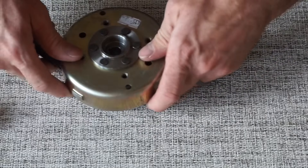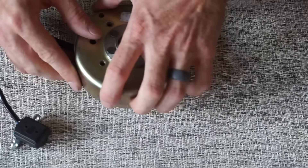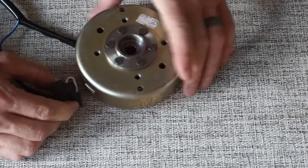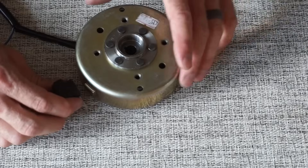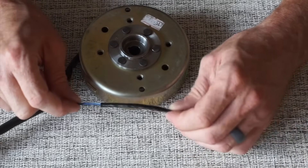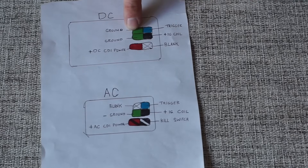You're going to have this trigger mounted to your engine. Notice this notch right here — there's a little notch. That's all that happens on the right side of the engine. As the magneto spins around, these aren't touching each other; there's about a business card's thickness between the trigger and the magneto pickup. This is the pickup coil, or trigger coil — whatever you want to call it. And when that spins around, it tells — see this blue wire? Blue with a white stripe. Most of the time, like 90% of the time, your trigger wire is blue. When that spins around it sends a signal to the CDI box. That's your trigger.